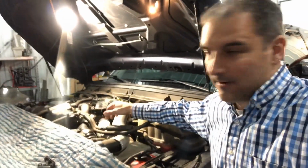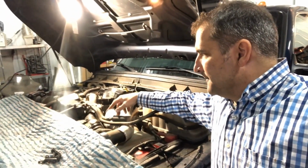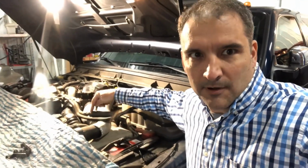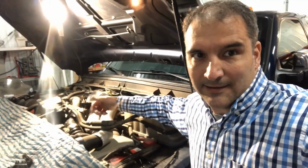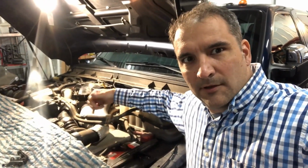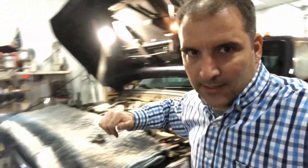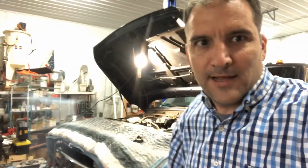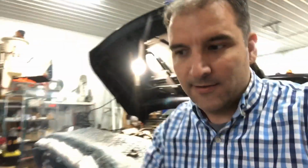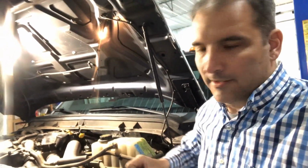So there you go. The third thing, actually this is the fourth, don't forget the O-ring that comes in your kit that goes between the pump and the block. I made that mistake. I tried priming the fuel pump with the ignition switch, and fuel comes out of there like you can't imagine. What I wound up doing after that was using a turkey baster to get that fuel off the top of the lifter galley. So don't forget that O-ring.